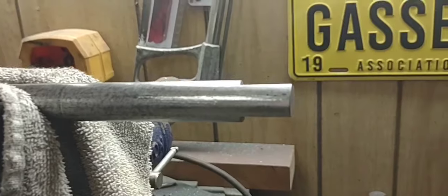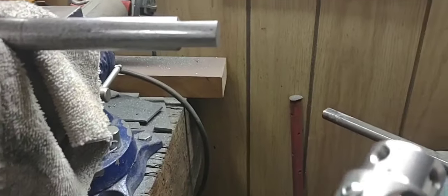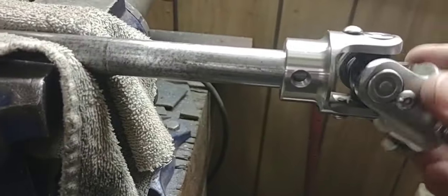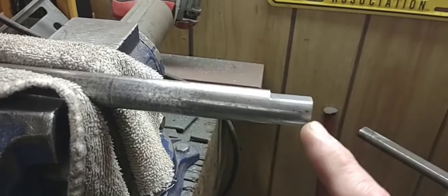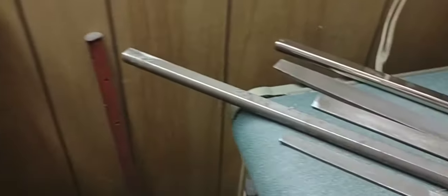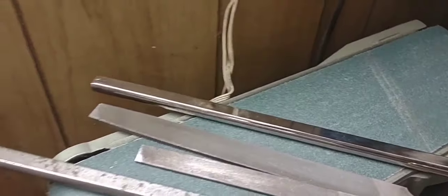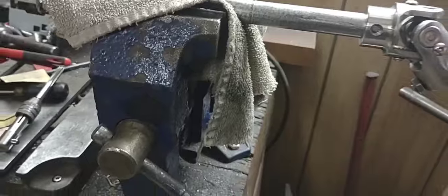I got that double-D cut on the steering shaft. Here's one of my Chinese u-joints and the double-D fits on there nice and tight — probably tighter than a double-D shaft you can buy. I got a raw steel one to use; I got a chrome one too but I'm not sure the chrome was long enough. One more part done — now see if I can get that bearing in that column.